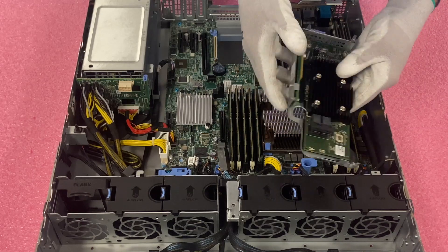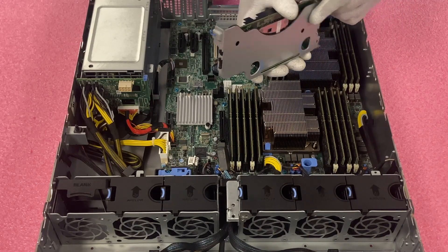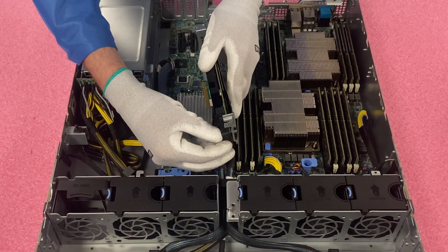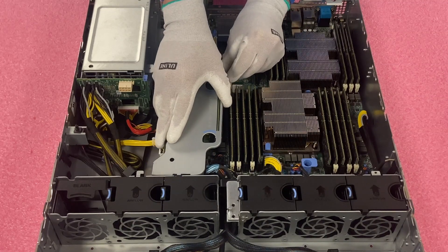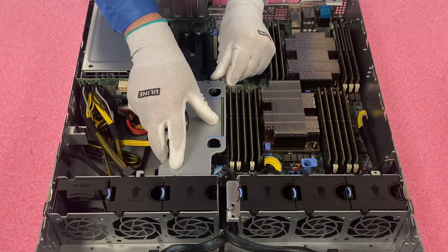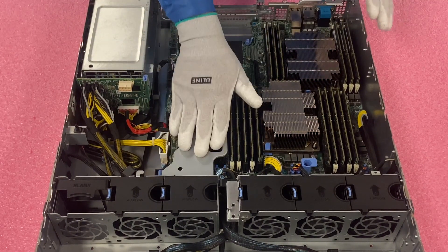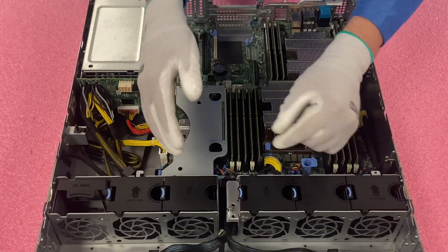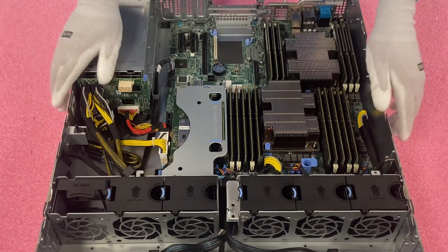You'll notice there's a spot right here — the tip of the bracket seats in, and everything is nice and flush. That's why I personally like the bracket, because it helps hold everything in better. Before we reinstall the riser, we need to connect the cable that goes from the backplane to the card. Just clip it in and make sure it pops in — there's not a lot of space, so be careful. Then swing it back around and install the riser, making sure the connections are seated properly.